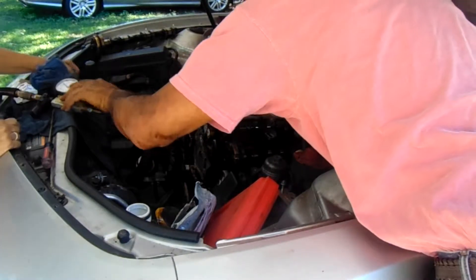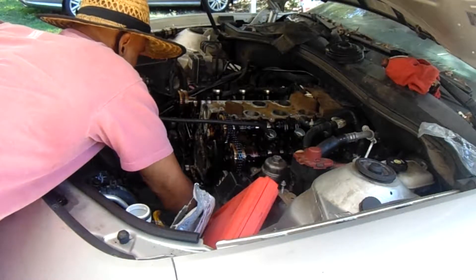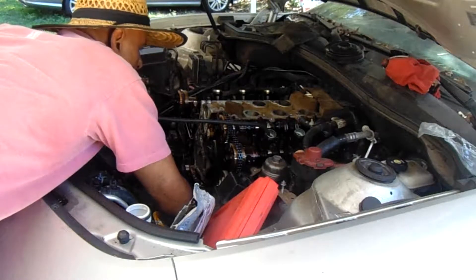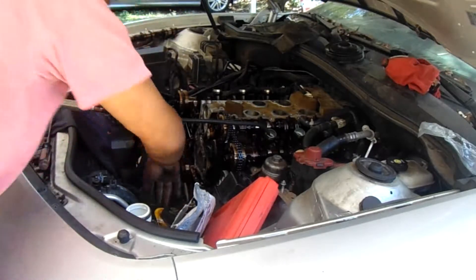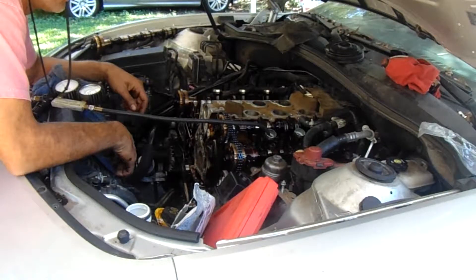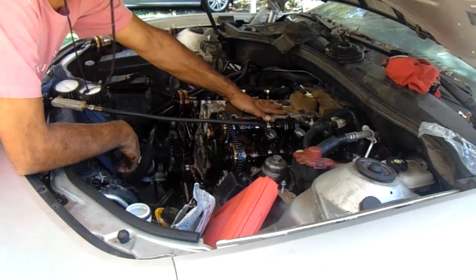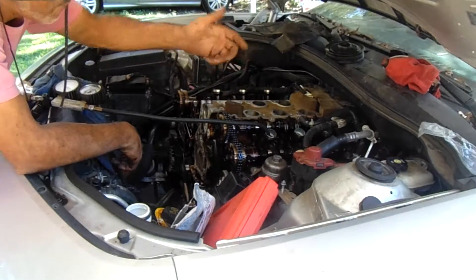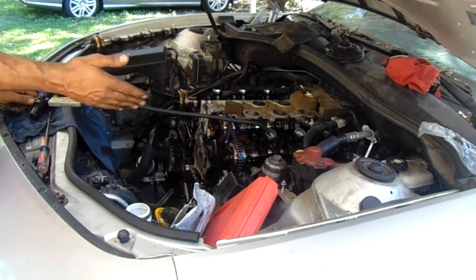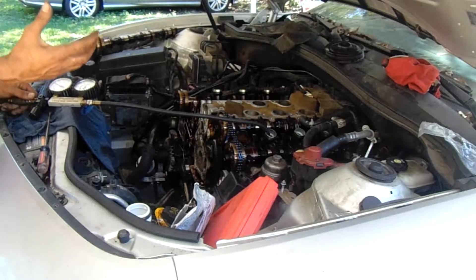The only thing you hear is that. But I hear something down here — that's going in the... it's just... it's normal because it might be going past the rings a little bit. It did have filthy oil. It's all good back here. We know it's not coming out of the intake. But the air is passing through the piston, so it's going down there. That would be a ring problem — the piston rings are not making a good seal.